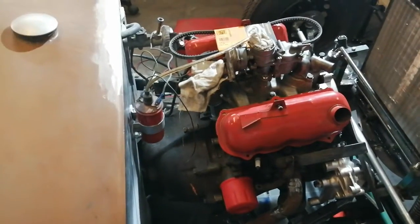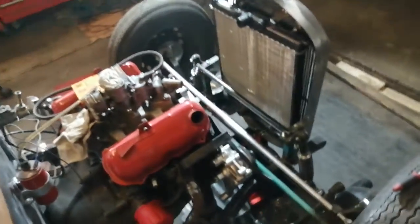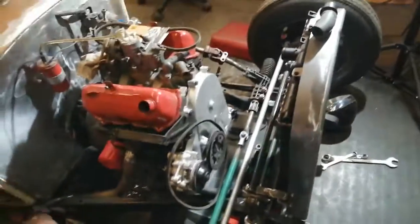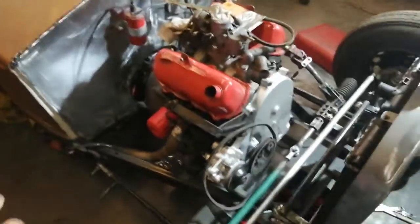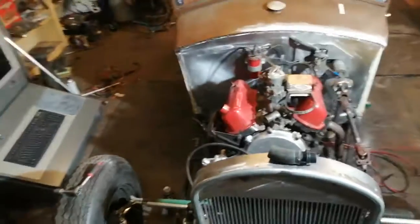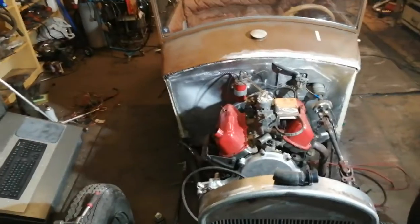and all the problem is, you can say, why don't you buy a 6-volt battery? Because all my lights, my gauges, my everything, spark plugs, I don't know if the sparks are 12 or 6 volt, but all that I bought for this car already and what is already installed inside it runs on 12 volt. Even to buy a 6-volt battery and swap everything, the 6-volt battery costs about double a 12-volt battery, and I have already bought a 12-volt battery, so it won't work.